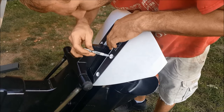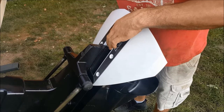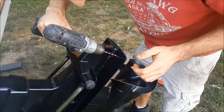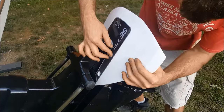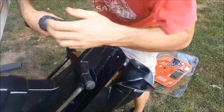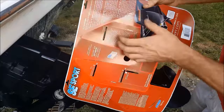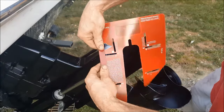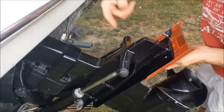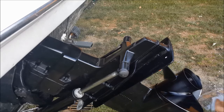Once it's lined up where you want, take your marker and mark dead center — this marker doesn't fit in the hole, so I'm going to use a center punch and a hammer instead. Go ahead and drill that hole out with the quarter inch. Now I'll slip one bolt in to hold it in place and then mark my other hole. For the front holes this fin is kind of in your way for drilling, so they give you this template. Fold it up, bring it to the bottom, line the bottom holes up, then mark the other ones from underneath and drill them from the bottom. Of course the prop is in the way, so let me get my angle drill.